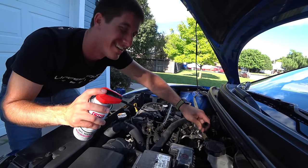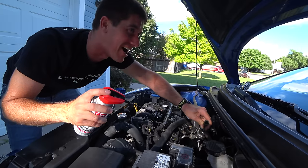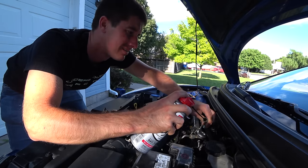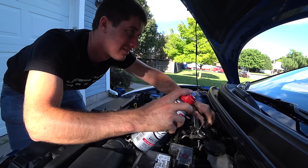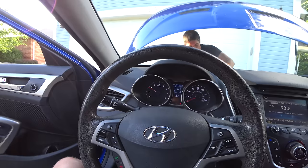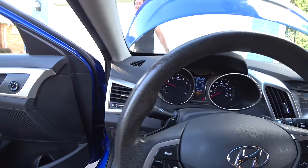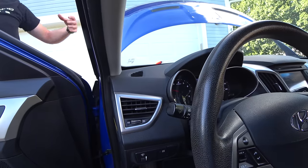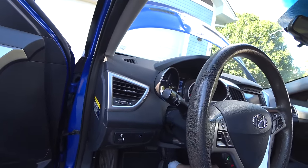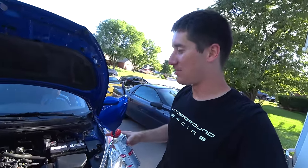It's really touchy — don't exceed 3,500. It's actually incredibly tricky to hold this at a steady RPM considering the varying amounts of fuel, air, and CRC going into the engine. It's burning my hands from holding that vacuum line right over the valve cover — it's crazy hot in that engine bay. There's probably a quarter can left. That seems like it would be the easiest task in the world, but I'm finally out of this can and the engine seems like it's running pretty well.